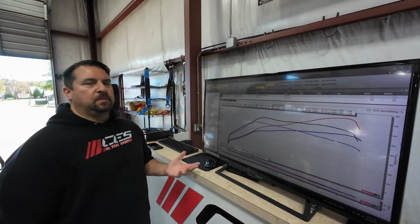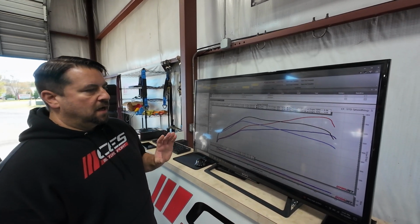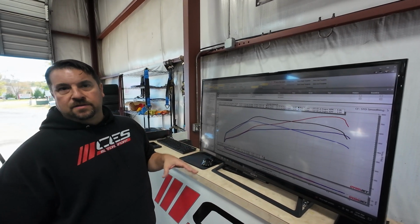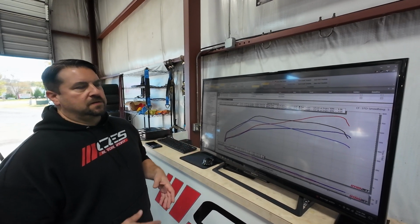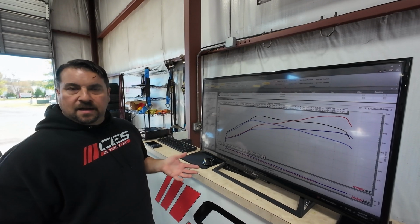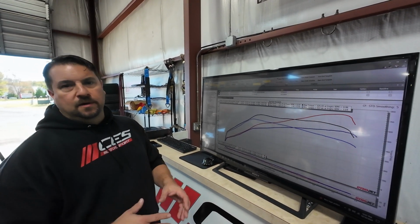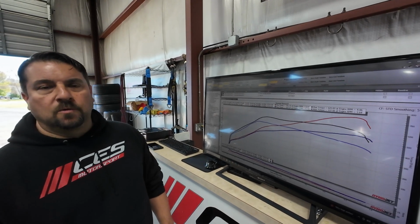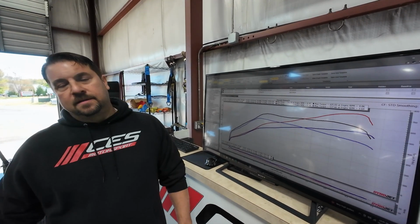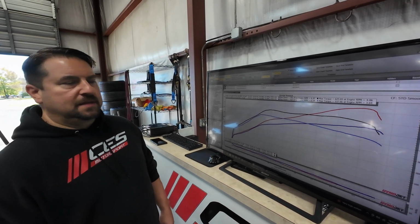We obviously did explain earlier that we are on MHD Plus tuning with Chris, CD919, and this is a full flex tune package that we have installed on the vehicle. So this is Motive Reflex with the ethanol content sensor to be able to read e-content on the car, and with the single flex tune we can tune anywhere from 93 all the way up to whatever ethanol content we want with the upgraded fueling package on the car that consists of the low pressure upgrade plus the PI system and the 750cc injectors that we have.